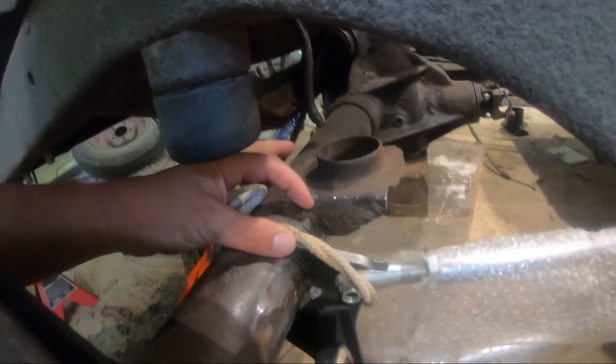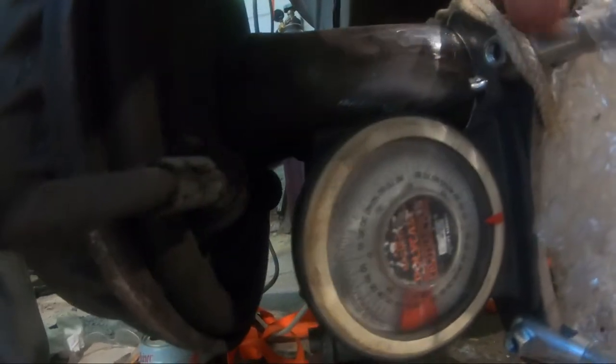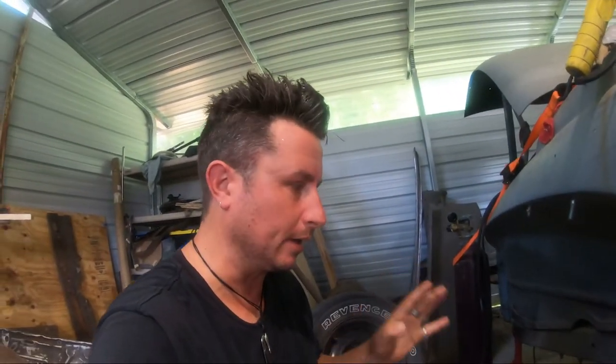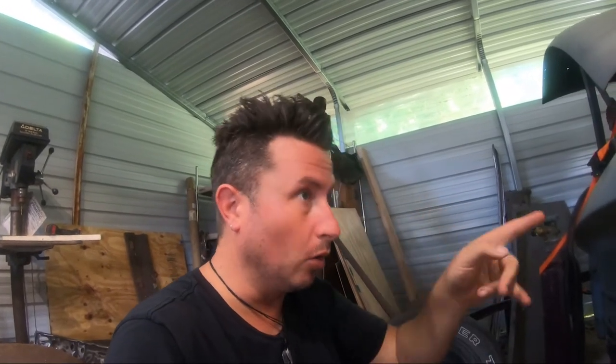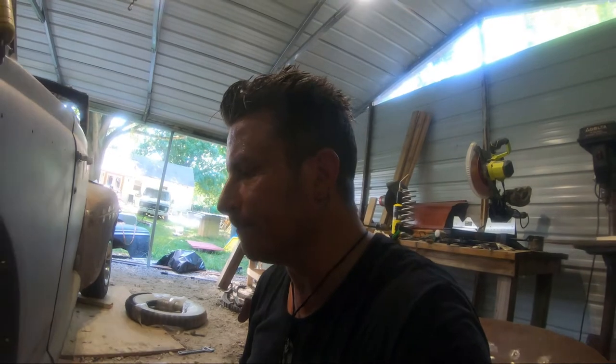Here's the plan on the back half. I'm going to make this distance the same on both sides, make this angle the same on both sides, and make this bracket level. Not 100% sure exactly why, but I feel like that's how it ought to be. The issue is this thing is laser cut for a three-inch axle tube and fits tight only if you're pointing it straight forward, perpendicular to the axle. Because the axle is a circular tube, as soon as you rotate that bracket you sort of need an ellipse to fit. So we'll be grinding away at that bracket to make it better, then find a way to match it on the other side. Don't want to grind too much out, but we've got to grind some.